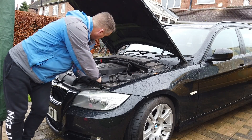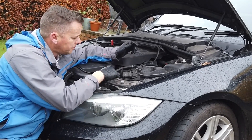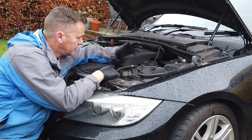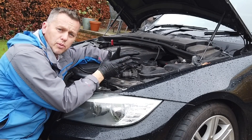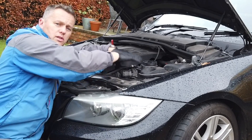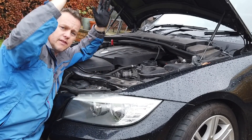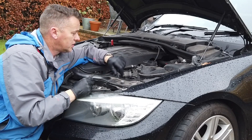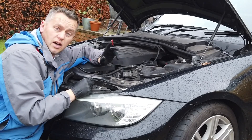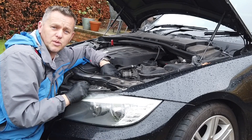Make sure that's down all the way. The reason being: we can't do this with a hot engine. These are running at 90 to 110 degrees, and water's boiling point is 100 degrees. If you take the top off, the coolant inside returns to atmospheric pressure and will blow in your face, giving you nasty burns. So always make sure the engine's cold before taking the top off. I hope that's been of use — if it has, drop me a thumbs up, like, subscribe, and thanks for watching.